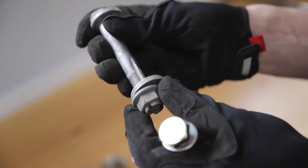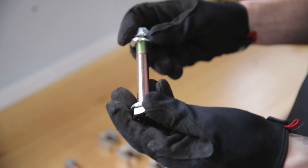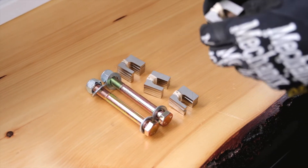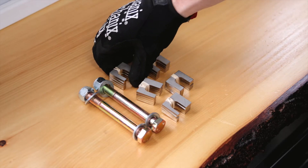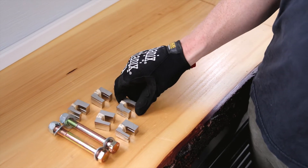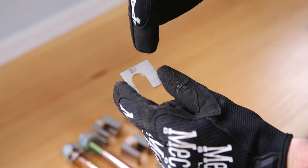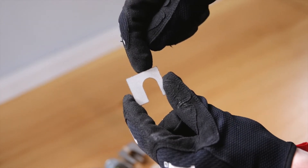These are zinc plated — corrosion resistant, so no worries going forward with the zinc plating. You're also going to have five packs of shims, four in each kit, and these are zero to four millimeters. You have nine different adjustments — you can flip either one. You'll use all four of one set; the others will be for extra adjustment in the future depending on how you want your alignment set up. They're all laser engraved with the millimeter markings — for example, three mil off center one way, and if you flip it, three mils off center the other way. That's how you get nine adjustments from five different sets of shims.